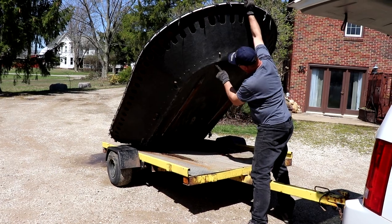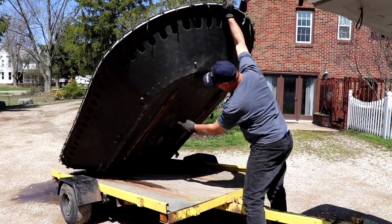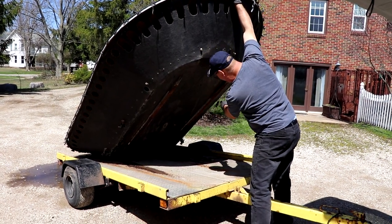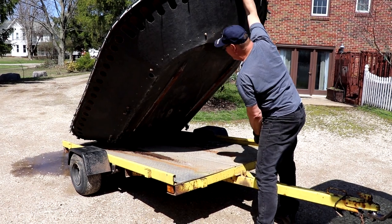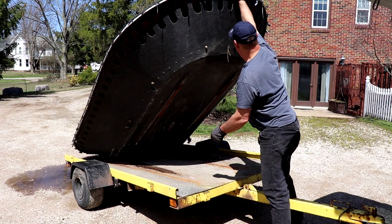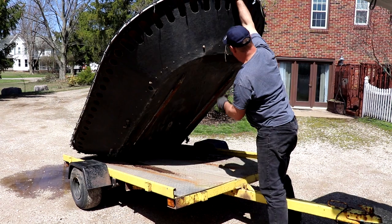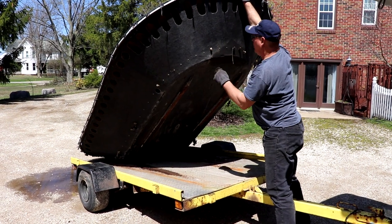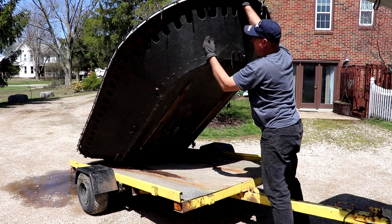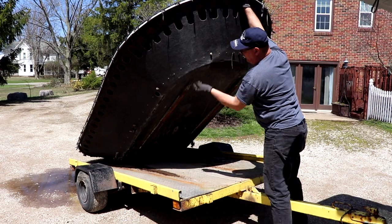Okay, I can see it's gonna need a little bit of fiberglass repair. These runners — I don't like the condition of the runners, so I'll be replacing those, but that's easy enough. All these are just rivets — we'll put new ones right in the same spot. Those hold the skirt. The air blows in here, the skirt's tied together, and whatever air escapes lifts the craft.